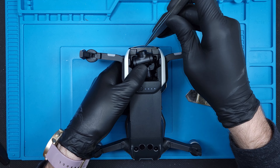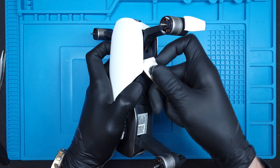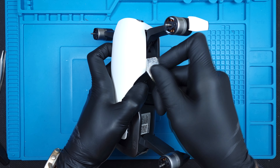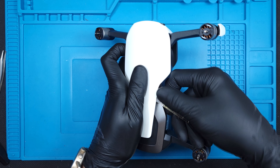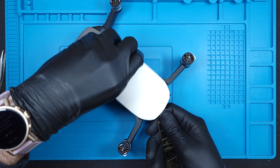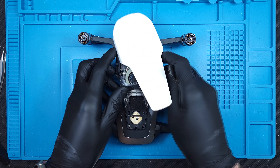Normally there would be two screws hidden up here by the gimbal, one of which will be covered by a silicone droplet. This refurbished unit does not have either, so we can get right into prying. The top housing is held in by plastic clips, and while some people seem to struggle removing it, it unsnaps pretty easily — just working your way around and feeling for the clips, popping them up one by one until all have been released.